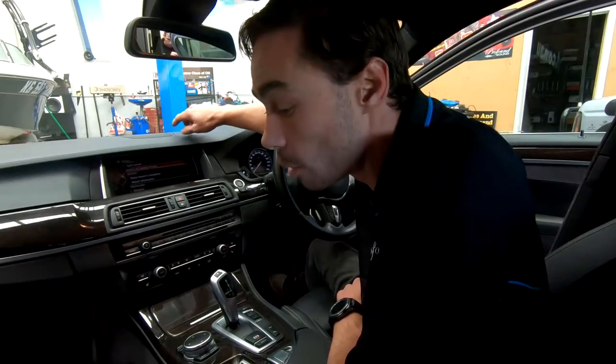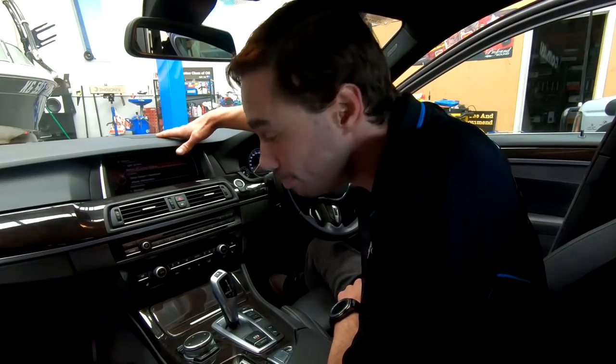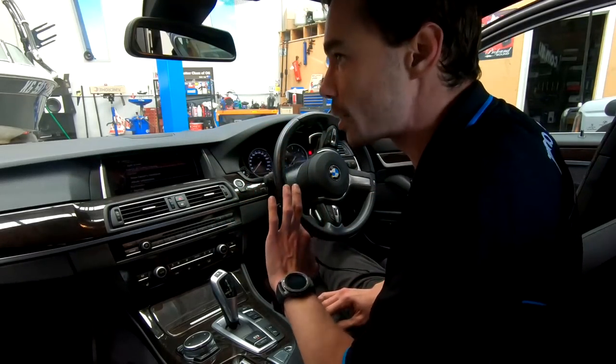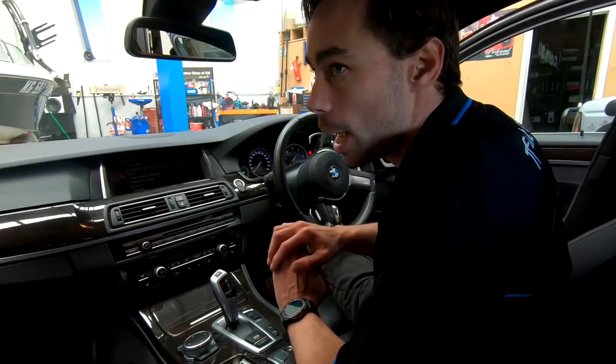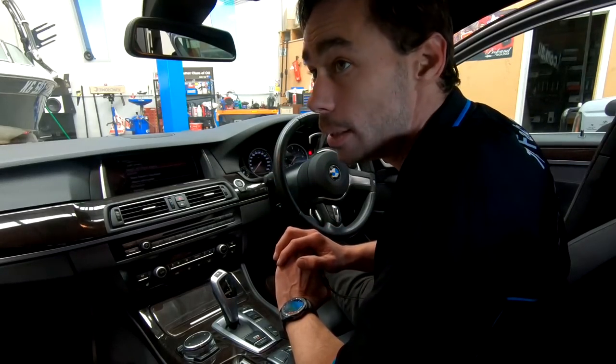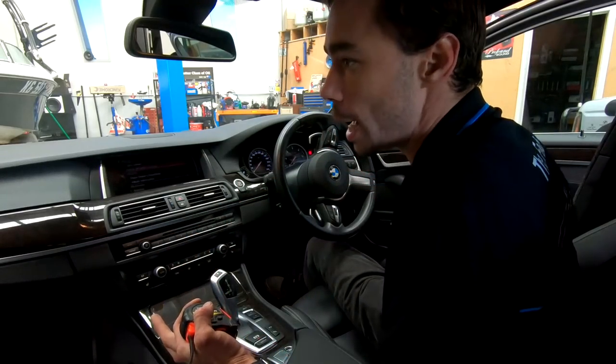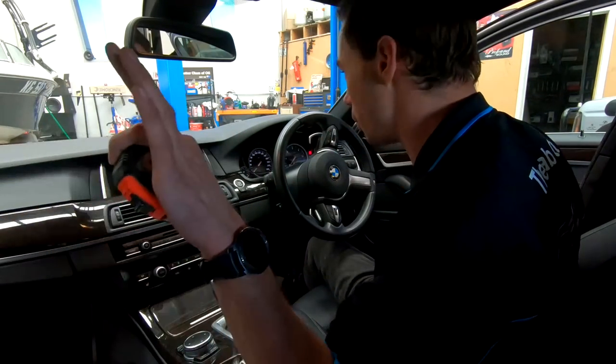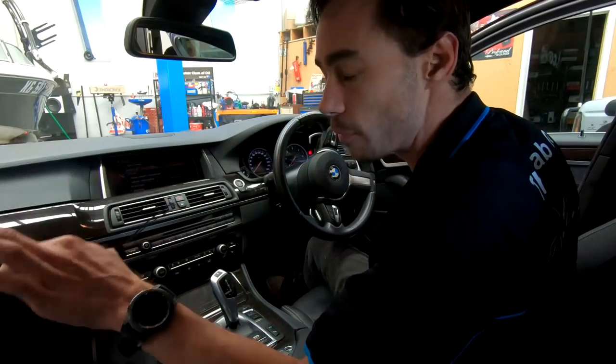Yes, it is being used and it is hooked up. I have tuned that as well, because obviously that runs through the processor at the same time. It's toned down a little bit. I've cut the frequency ranges that it's using, but it does actually add to the center image. Generally when I'm doing time alignment to fronts, you would run just with the speakers and time align it to get a center image just with the front speakers.